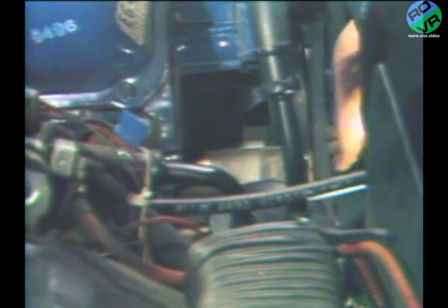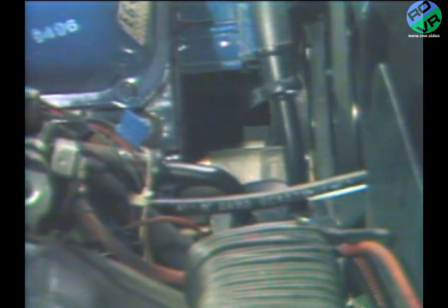Do you see any pinched, burned, or disconnected wires? Is the alternator drive belt extremely loose, or even broken, or missing completely? Do you have a blown fusible link in the cranking circuit? Two minutes spent conducting a good visual inspection of all likely parts and points that could cause the problem you are trying to solve is time well spent.